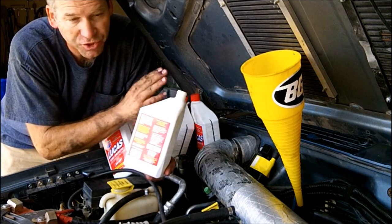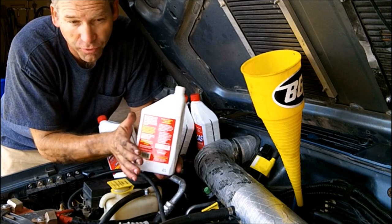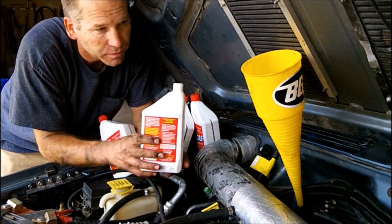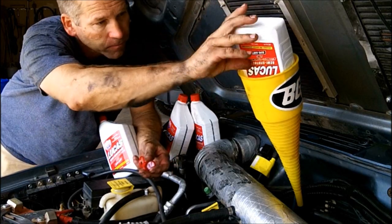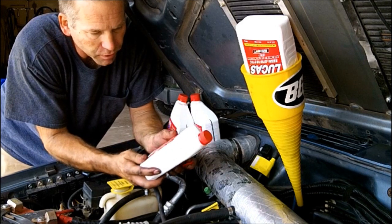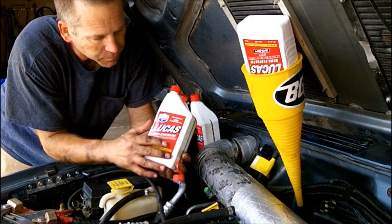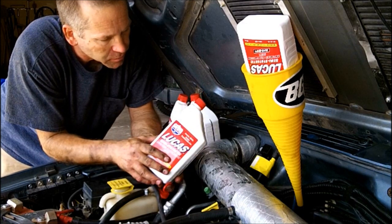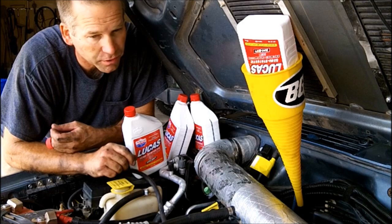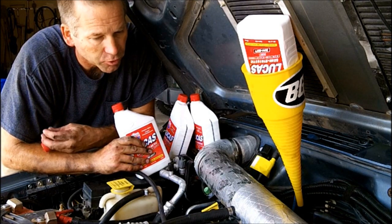If I was just doing a filter like I just done, I'd probably put — it's probably safe to put four quarts in this. But let's say you put three in, you fire it up, and then you check it. You're low, you add — because you do not want to overfill your transmission. I'm using a Lucas semi-synthetic automatic transmission fluid. This is a Dexron III type fluid, for Mercon — not Mercon V or anything like that. But I've used this one before; it seems to work awesome. This is a Japanese transmission in the Cherokee and this particular transmission takes Dexron III — it does not take ATF+4 like you might put in a Chrysler transmission.